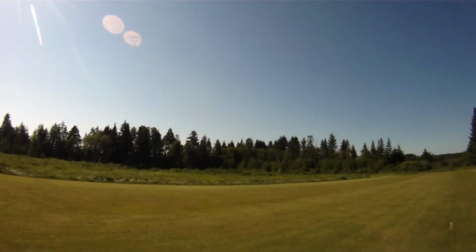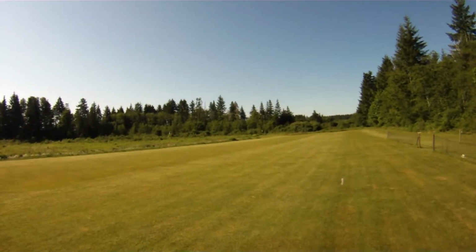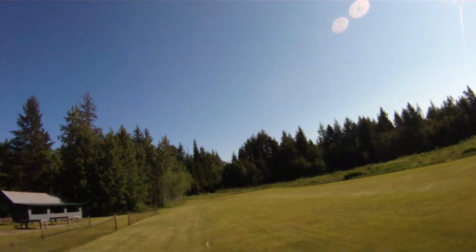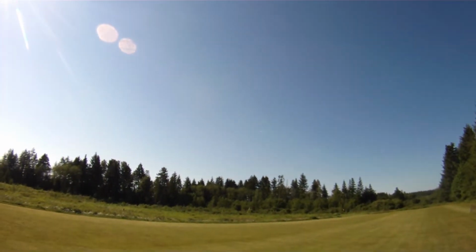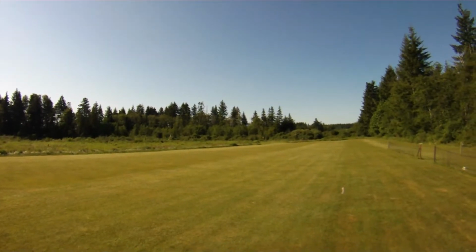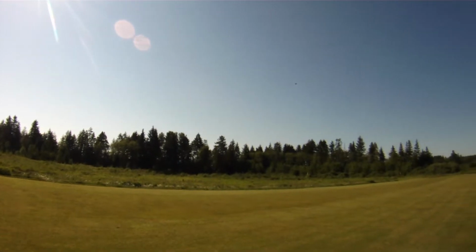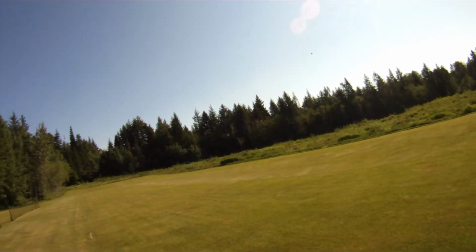Yeah, it just doesn't seem to, and I mean, we're only talking small percentages here. We're not talking that it's horrible. It just doesn't seem to be able to wind the prop out quite as well, with maximum power right to the end of the throttle range. I'm not sure, maybe because of the different size stator. Maybe the 2306 being a little wider produces a little bit more torque, I'm not sure. But for a $17 motor and a very, very popular speed controller, the Turnigy Plush 40 amp, I can't complain.